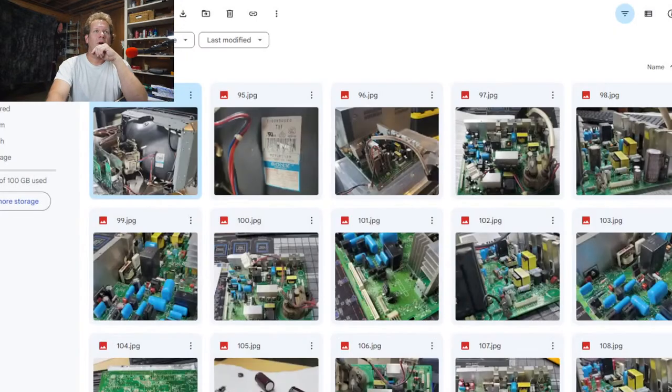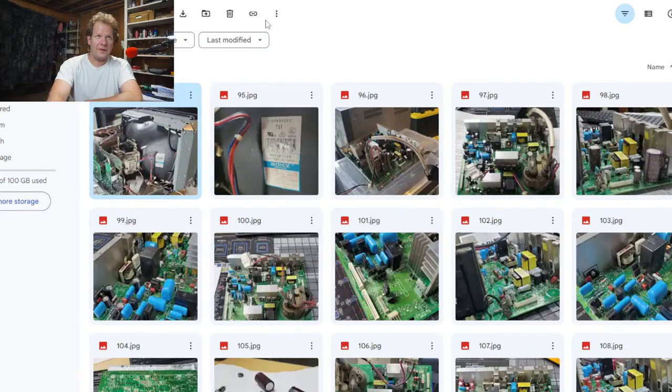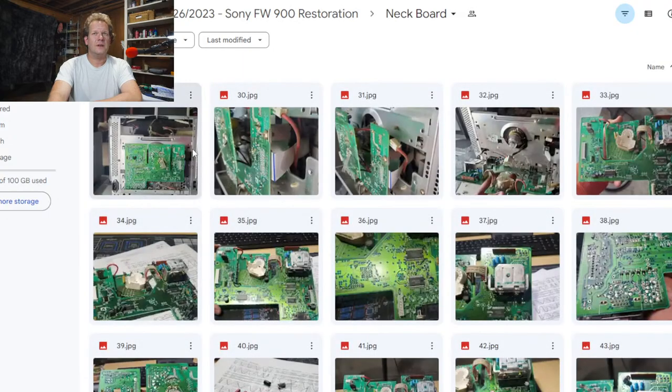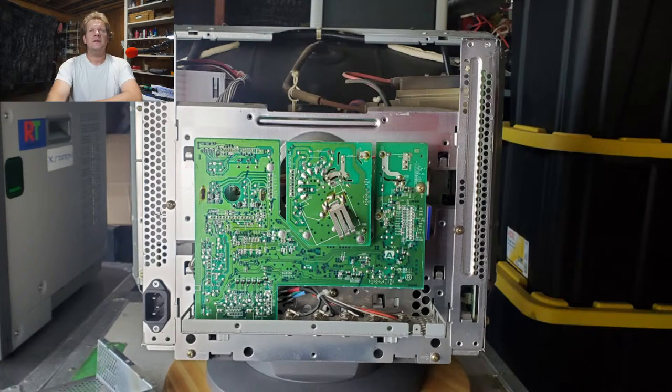Here's just a picture of that board reinstalled. The heat sinks on here go through the whole board — those heat sinks actually tie into the shielding, and then that comes over into this shielding, which ultimately taps into the shielding here, to make this a giant heat disbursement system. There's no active cooling going on in here — no fans or anything. It's all passively done through heat sinks, and then air going through the vent holes on the sides of the CRT. That's actually the last photo on that particular board.